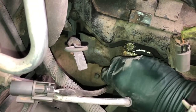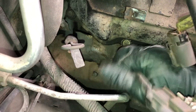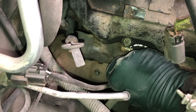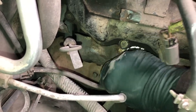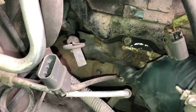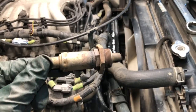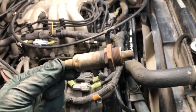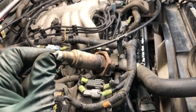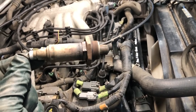This thing unthreads much like a spark plug. So we'll go ahead and get this out of here. It's still very hot as the engine is still quite warm. I'll go ahead and just loosen this counter-clockwise until the oxygen sensor is out. Something happened here that occasionally happens — the bung that the oxygen sensor screws into on the manifold came out with the oxygen sensor.